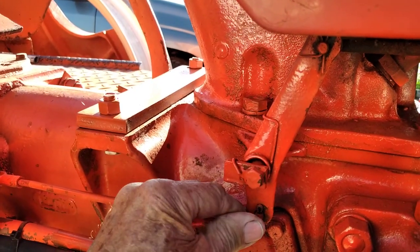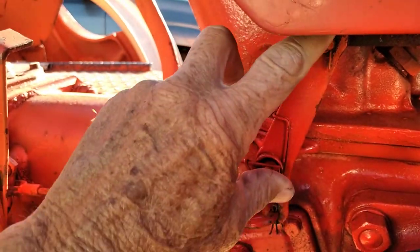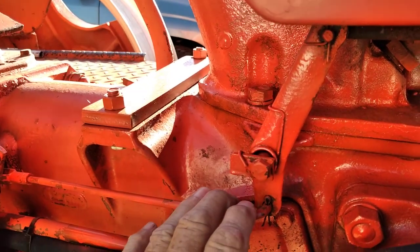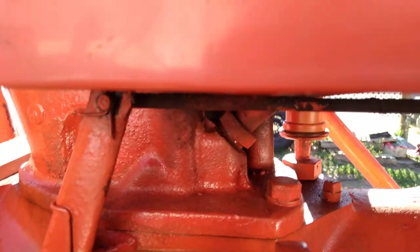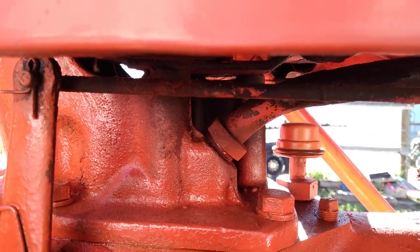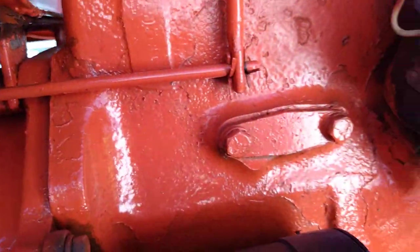This has a ratio of approximately four to one, maybe three and a half to one, something like that. So whatever little motion is on the throttle is grossly amplified by that push rod up at the top. Now you can see that push rod traveling — another push rod off that bell crank, traveling forward.